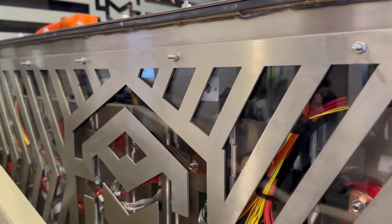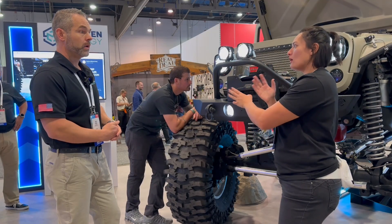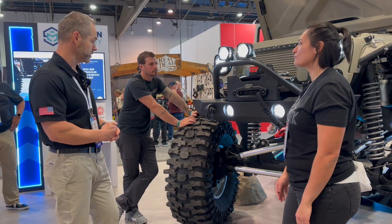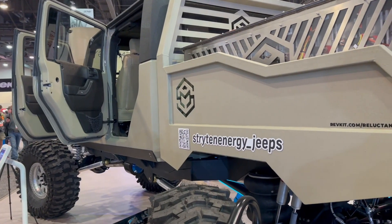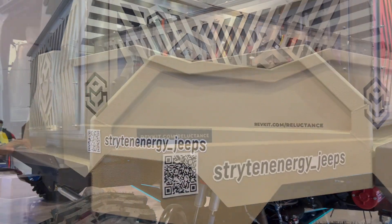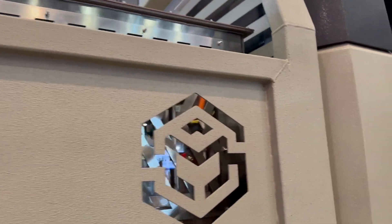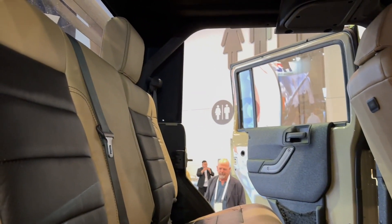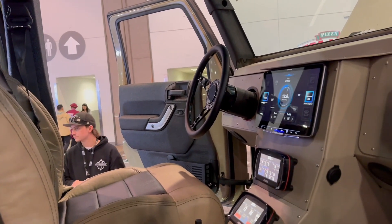And that's why you wanted a bigger off-road vehicle. Is this meant to do more rock crawling or go fast? It's going to be slow — that's the intention. With the additional ground clearance, it handles water crossings and large obstacles. Getting back to the electrical side: the ability to power the batteries means when you're in the woods with no EV charging stations, you utilize the diesel for that. We also have an identical EV motor attached to a custom transfer case — an IM425 made by Cascadia Motion, owned by BorgWarner. The IM425 makes 550 horsepower and 2,000 foot-pounds of torque, so it's very good for pulling heavy loads and spinning big tires.